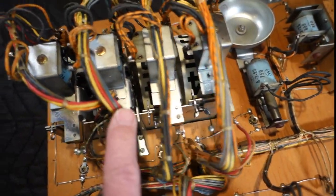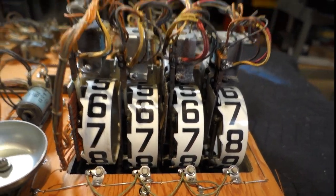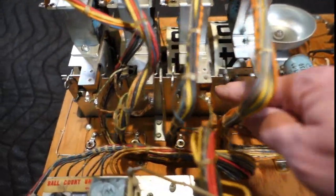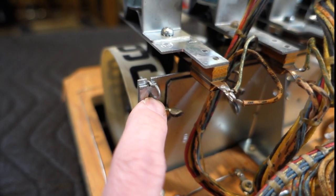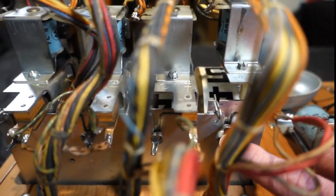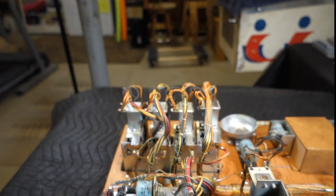We've got the score reels and these don't look too bad, but I'll take each one apart, make sure it works, and clean the switches. They're pretty clean. One more thing on this side — I noticed one of these was not put back in all the way. It's got a hole for this clip and the clip goes here on the first three, but the last one — there's the hole for it and it's actually above it. No harm done, it just doesn't look great from the front through the glass.